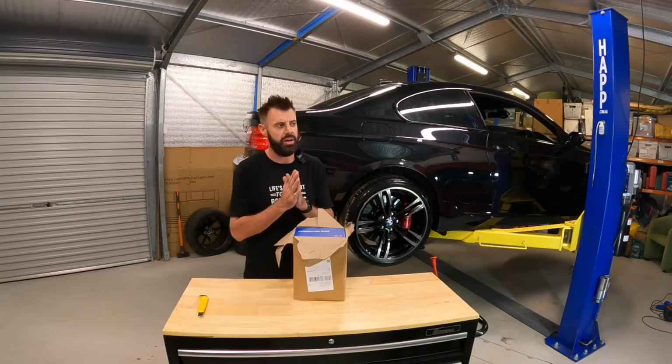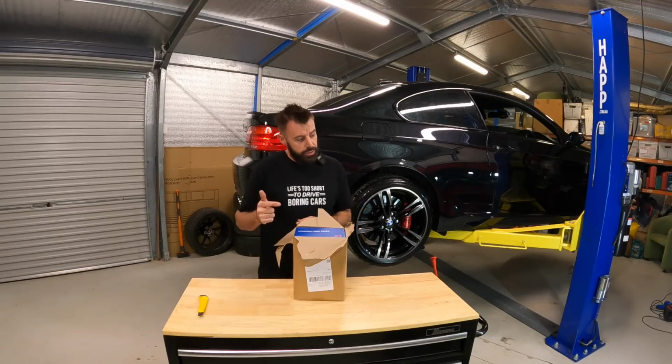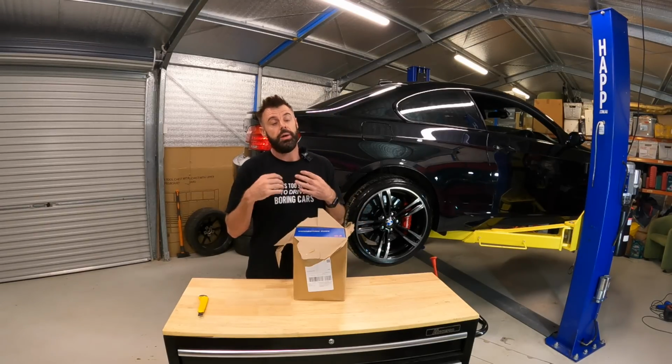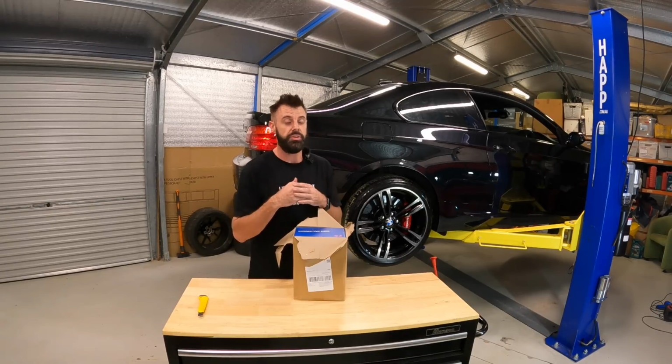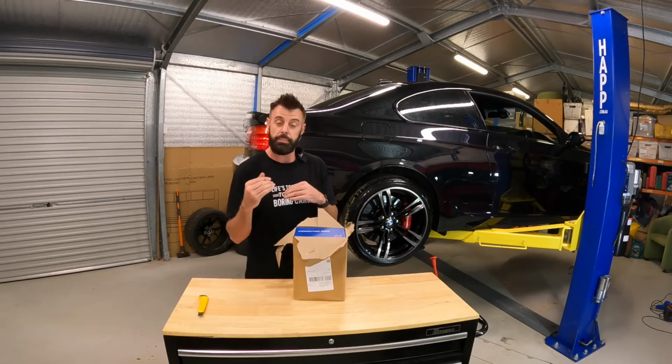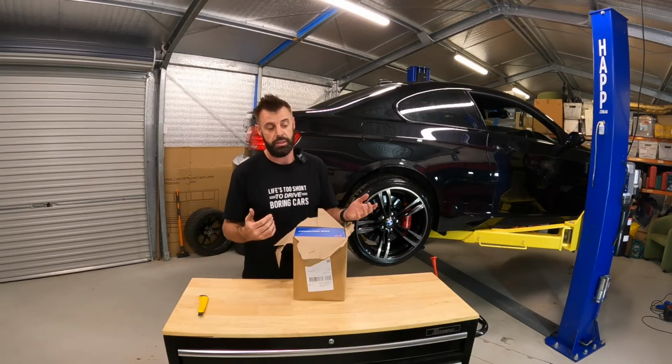It was 27 PSI. I think we had it at about 12 degrees of timing when it melted. Or maybe that was the map that I had to go on. And it was never really working hard, but I did melt an engine. Now, because of the way that we film the videos, a lot of the stuff goes up raw. It's not necessarily planned. It's just our day-to-day experience of playing with and modifying and fixing BMWs.